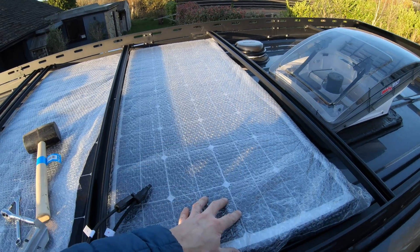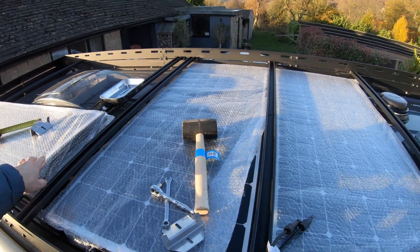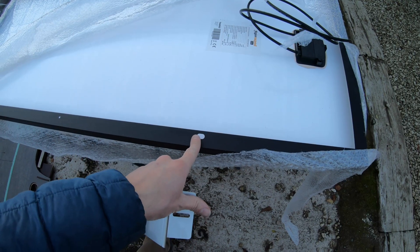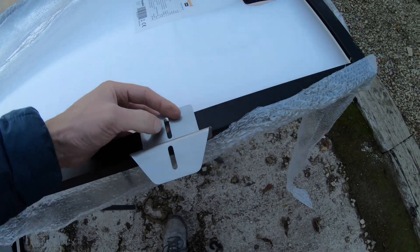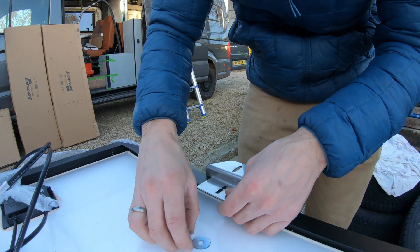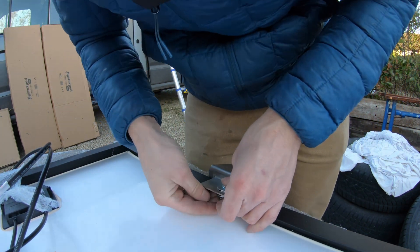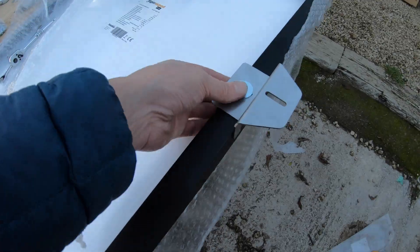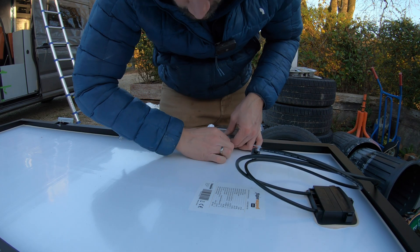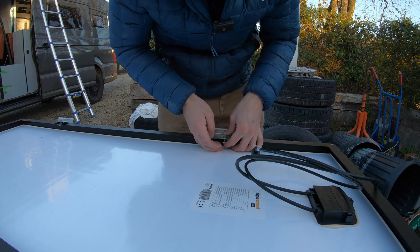Next thing I need to do is drill the solar panels and attach the brackets. I'm going to bolt from this end first and work forward because I've got a bit more room to play with down there. Looking at the back of these panels, conveniently they have holes in there already. All I need to do is nut and bolt in there. Going in: penny washer, penny washer, spring washer, that on there, and then nylon nut on the bottom. Done — that's how they fit. Four more to do; by using the spring washer and the nylon nut that will stop it coming loose, saving your job because these are awkward to get to. You don't want them rattling around and you don't want them blowing off.